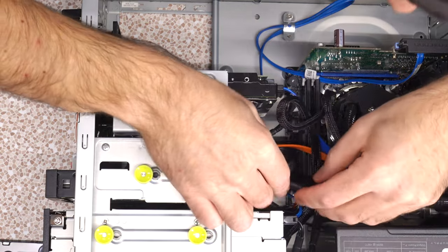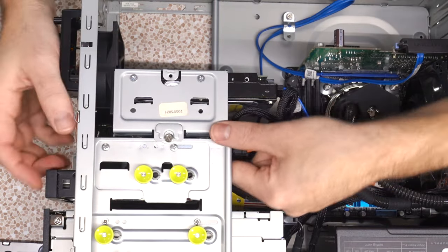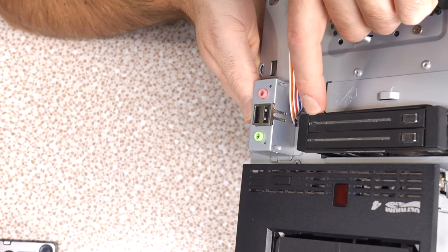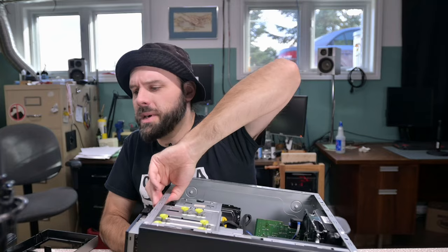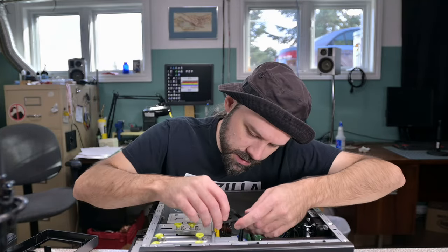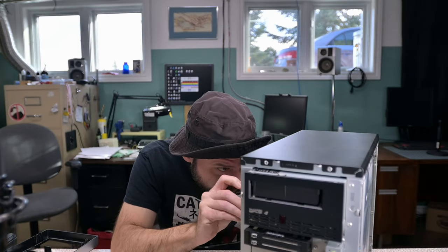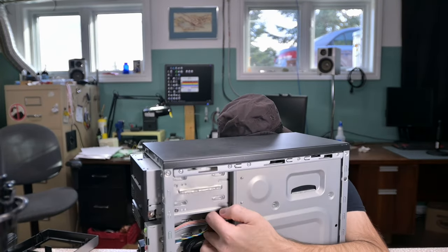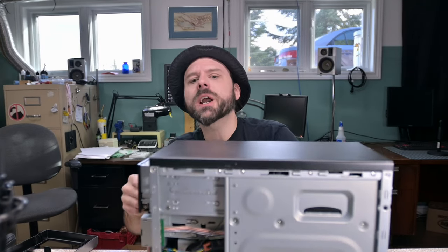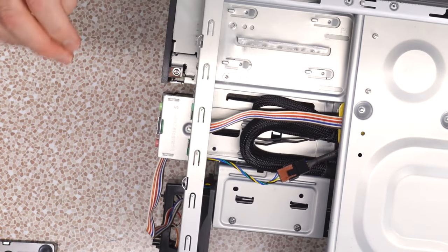Okay, so we have one more SATA power connector. We're gonna go right onto the drive with that. Now these little adapter bays have power adapters and they're mostly just to make the light chooch. That's all they do. But we're going to be bypassing that and basically connecting SATA power directly to it. Then figuring out how to strap these cables back down, bud. There's a couple little holes right in here. Oh, tricky, tricky. You know what, we're gonna use the top bay. There's a nice chunk of airspace up there. All right, we got our rear cables strapped back down.